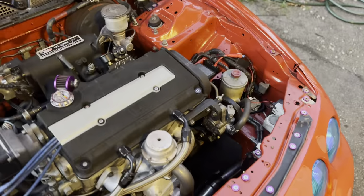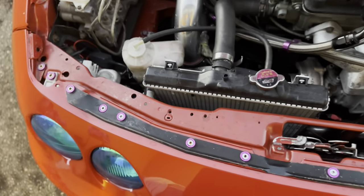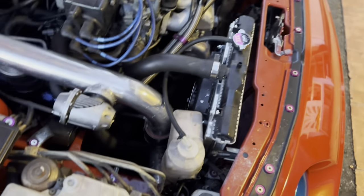So now I was only getting to about 215, 218. I think the worst that it got was like 219, which still isn't really where I wanted to be, because the Honda manual basically says that the car typically runs on the higher side, about 209-ish. So the next thing that I realized was that I did have a slim fan, and it was an eBay slim fan.